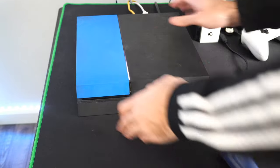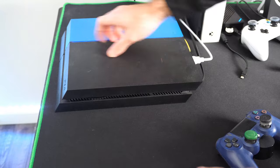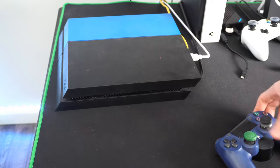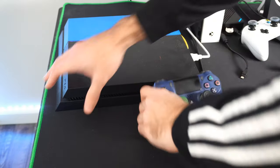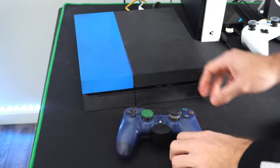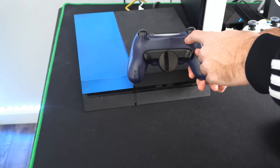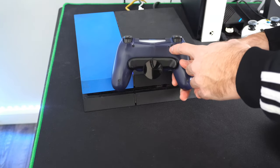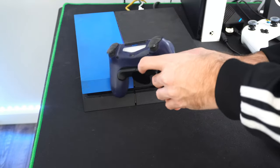Now rotate your PlayStation around when it's completely turned off and then unplug it from the wall outlet. This will power cycle your PlayStation. Then turn your PlayStation back on once you've power cycled it. On the back of your PlayStation 4 controller there is a little pinhole that you can press in to reset the controller — use a toothpick or something similar and just press in there.